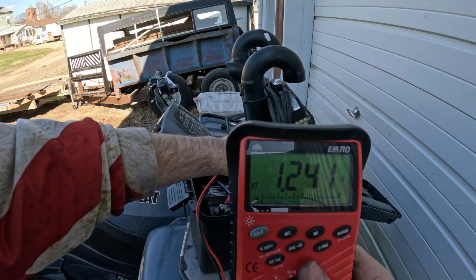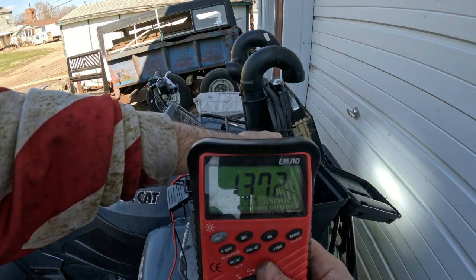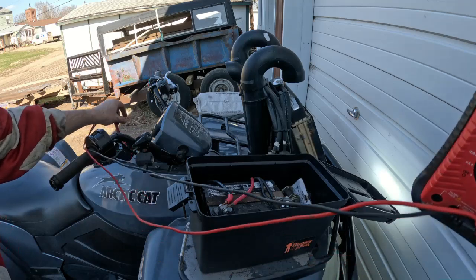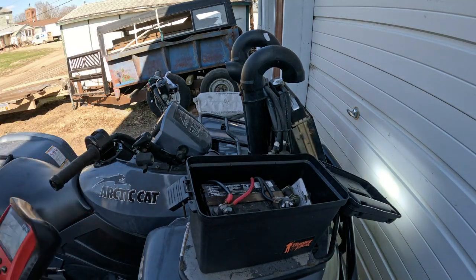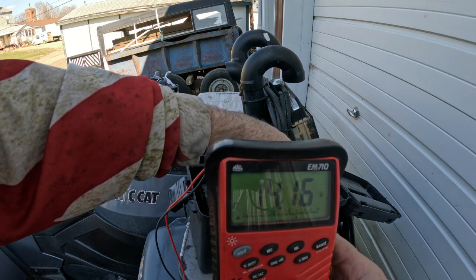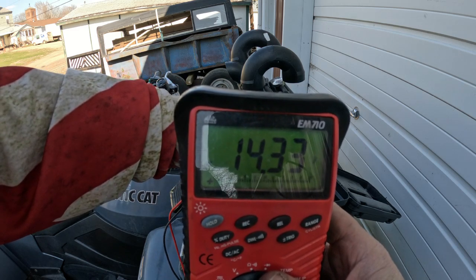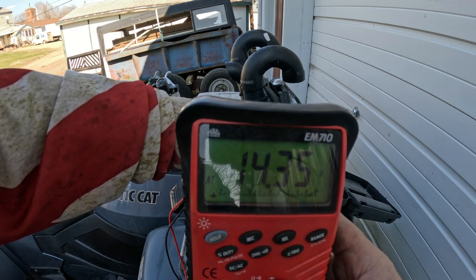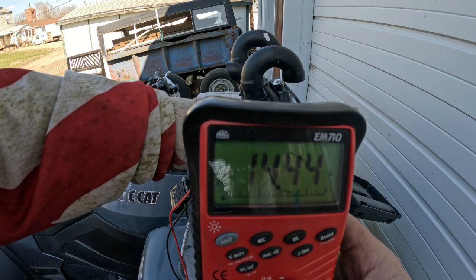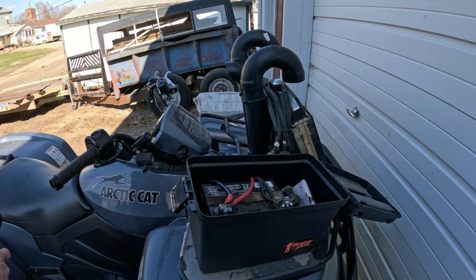Let's see if it works. Just so you guys can see — standing voltage is at 14, still a little high. Turn on the LED light to suck off some of this voltage. There, it's coming down. Okay, LED light off — there we go, 14.2, 14.3. Those are the numbers we're looking for. You can even see it bouncing around a little bit — that's perfect. No more volt light. No more worrying about burning up the ECU.